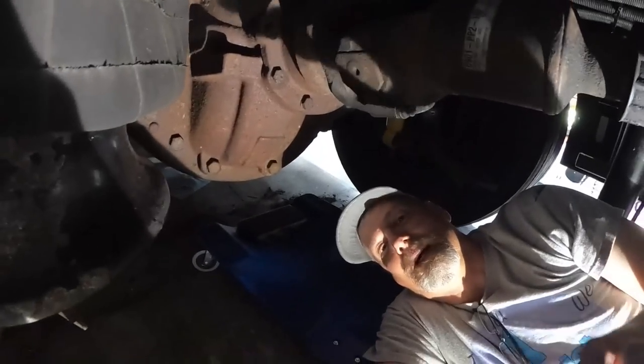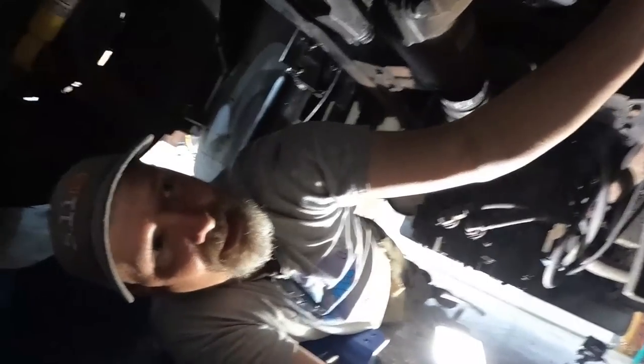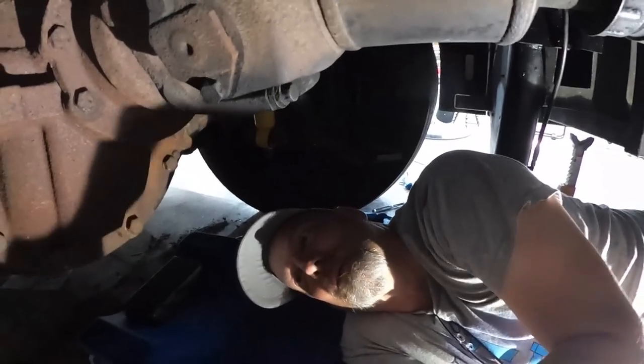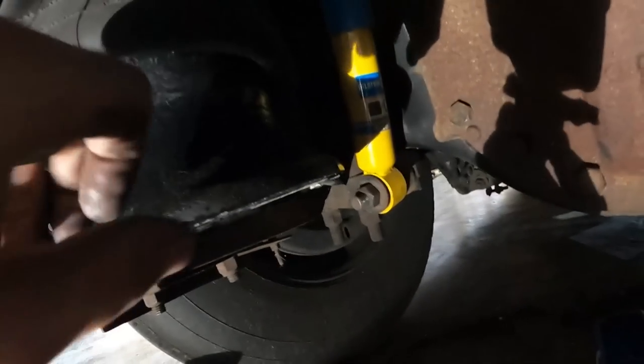And by the way, that was because I was going to get new fittings and they didn't happen. But so I need to break that and break the bolt, get the line off, break the attachment point there for the air, and then I'll break the top first, unlike the way I did the other one. I'm pointing to this side, the bolt's on the far side up here. But that way, it won't sit there and spin while I'm trying to get it off, and then I'll use the air hammer to get the bottom bolt off last.